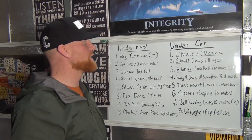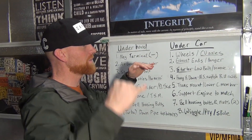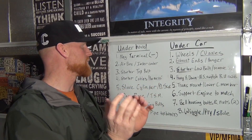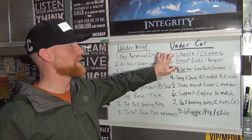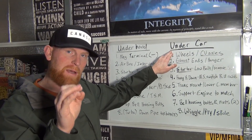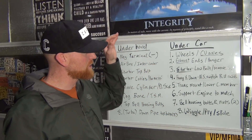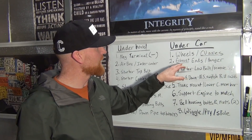We've got the car lifted up at least to get the front end off the ground. You can lift it up, put jack stands under the front, then lift up the back by the rear diff and put blocks underneath. Make sure your emergency brake is on and your rear wheels are not going to move. Safety first. Wheels and CV axles — that's what the part one video covers. People are going to get hung up on the content in this video or the last one. I'm covering the hard stuff that takes 80% of the time — that 20% of the job that takes 80% of the time in work and effort. That's why this video is the best. Exhaust ends and hangers come after CV axles; I go into great detail about that in the previous video.